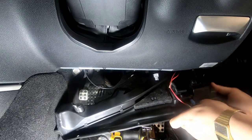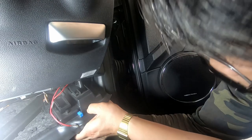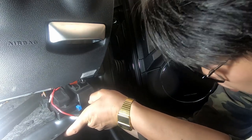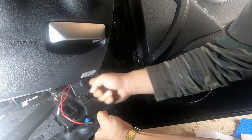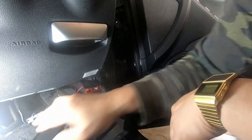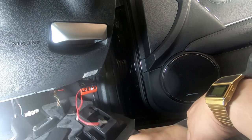To remove it, you just have to push this through straight — you don't have to turn it any way, just push it straight through. Get it through the gap and continuously push it through like that — it just comes out like that. Then you just have to turn your footwell light to the left and unplug it. And that is how you remove this lower panel.